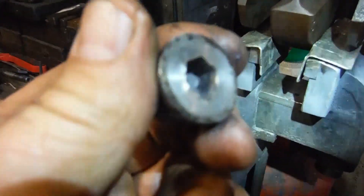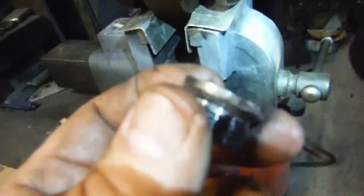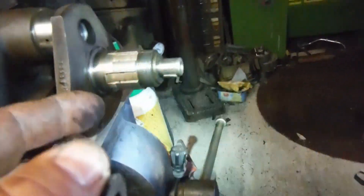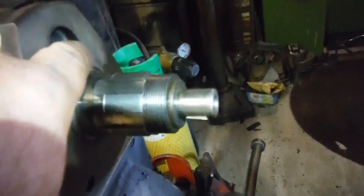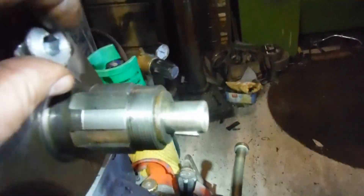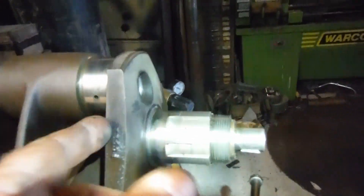After a lot of effort, I first got one out without too much difficulty but the other one was harder. Basically these are aluminium, and a way to get them loose — if you've got access to a propane torch or gas torch, something that can get things pretty hot pretty quickly — is to warm the plug up, get it nice and hot. Don't turn it blue or anything, but get it really hot and then let it all cool down. What will happen is the aluminium will expand more than the forged steel crank will expand.